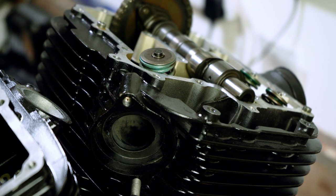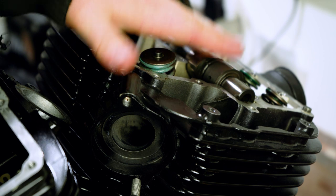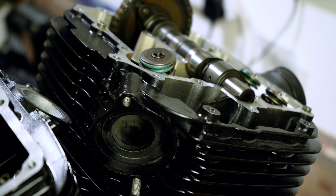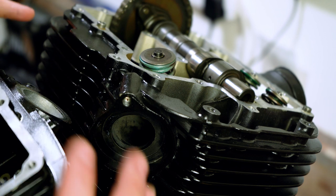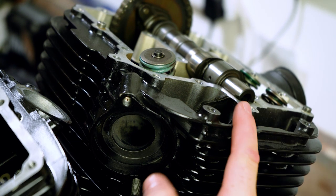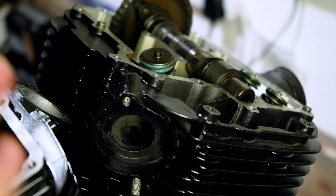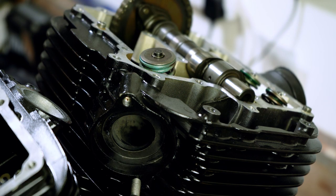We can start moving on to actually installing these cams. I know I've got these cams already installed — on this part of the video this was an afterthought. I completely blanked it and thought, I need to go back and tell you guys about this because it's incredibly important. If you time the engine without being on top dead center on the rear cylinder, you're going to have a whole lot of problems. But now we can fast forward a little bit and the next shot you'll see is the cams, chains, and everything being assembled on top of the cylinder.